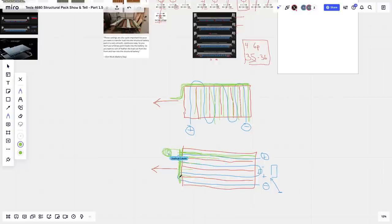Joshua acknowledges the advantages of the longitudinal design but raises a disadvantage: the transverse configuration has more heat rejection capability per coolant run because each tube is shorter and touches fewer cells. The longitudinal cooling tube is roughly twice the length of any current Tesla production coolant run (including return). However, one longitudinal tube in this design cools about 71 cells versus 144 cells per tube on a Model Y 2170. The net thermal performance difference under supercharging at a pack level would need to be analyzed.